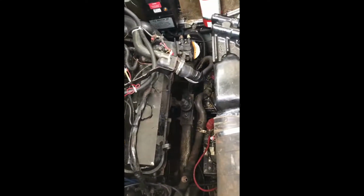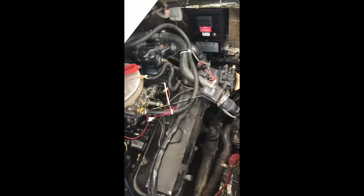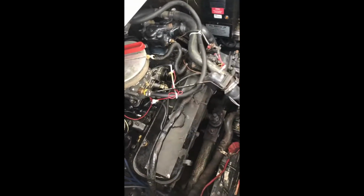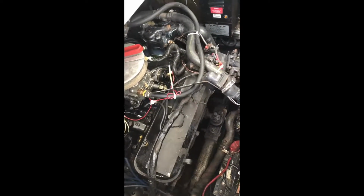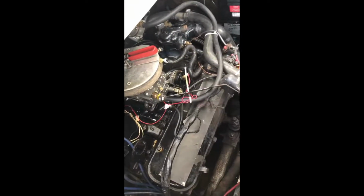And of course, my first thought was that my riser leaked inside of the manifold and filled up that side of the engine with water. But it turned out that wasn't it. I took the riser off, filled the inside of the engine with oil, and cranked it over a few times to make sure that nothing seized, so I was ready to put on the new manifolds that I bought.